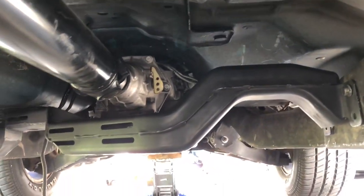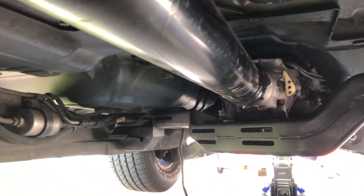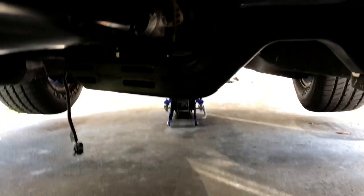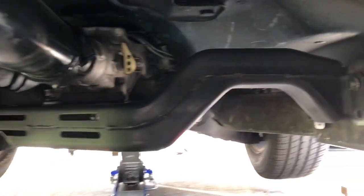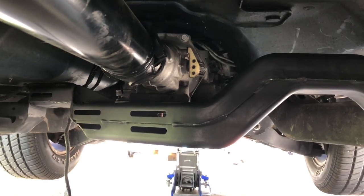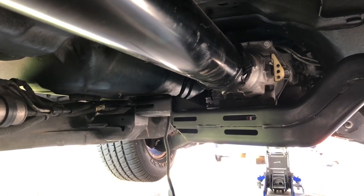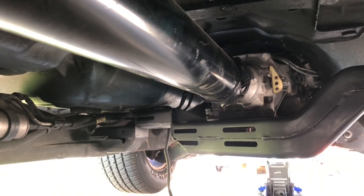After all that cutting and welding, this is the result. Sorry if it's a little bit shaky - I'm just trying to hold the camera underneath the truck. I've got a little room there where I can run the exhaust through. The transmission is supported by the crossmember, and we've got everything where we want it to be. I hope this helps you working on your project, maybe encourages you to reuse your old crossmember instead of spending several hundred dollars on a new one. Make sure you subscribe so you can check out my other videos for my S10 swap, my V8 swap, get some ideas, help you out, and hopefully make this easier for you. Thank you very much for watching.